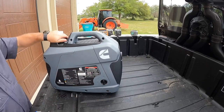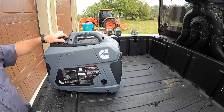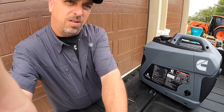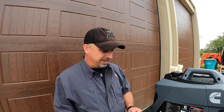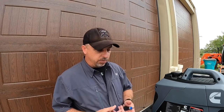Make sure you're topped off on the tank — we're at the very top — and this generator is ready for storage. Even generators with gas valves may have a drain on the bottom of the bowl, and if it's accessible, I recommend draining the bowl every time. Done this way, you're really good for long-term storage — I'd say six to eight months no problem. But I'd start it up around eight months, fire it up, let it run a little bit, and shut it back down. You never know when you'll need them for a storm or hurricane.